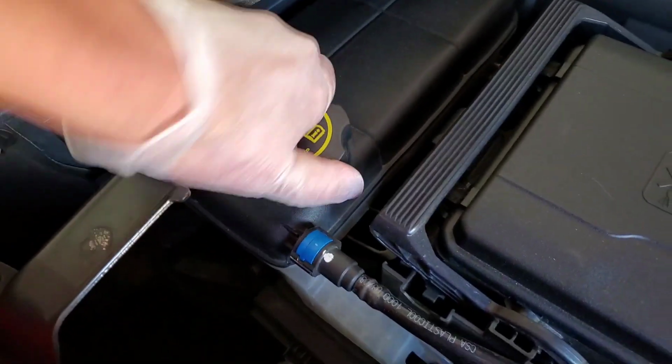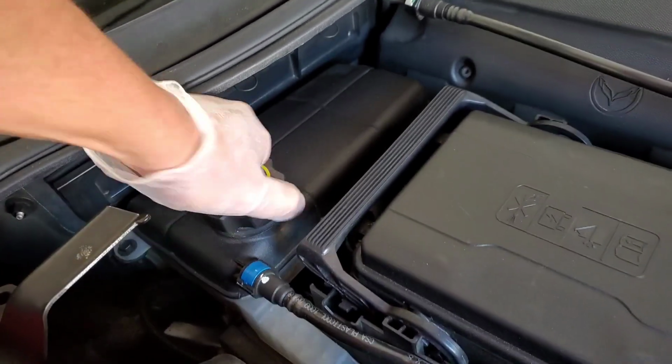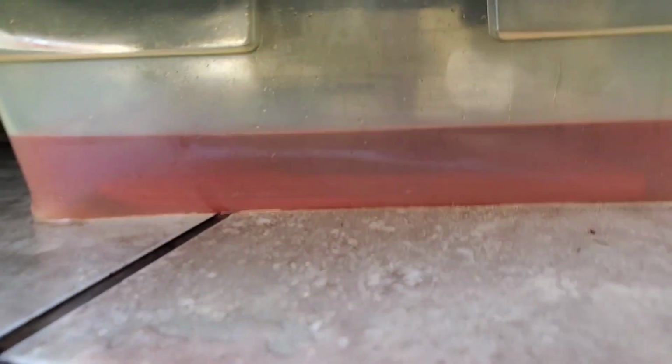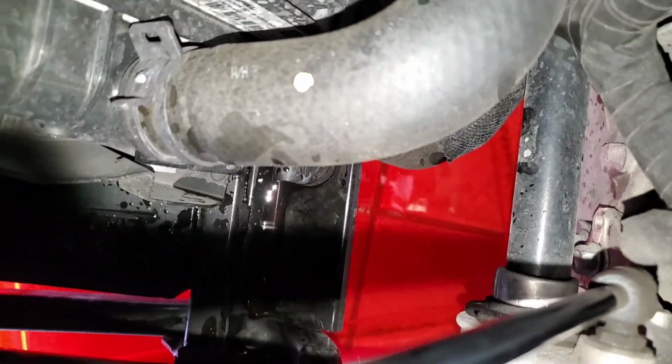We're going to open up our coolant bottle, and we're going to cleanse that out good. Oh, sounds like more's coming out when I open that. Yeah, a little more's coming out. So definitely open that in the beginning. It'll help it come out quicker. Yeah, you're letting more air in. All right, now we're going to cleanse the system with our distilled water.